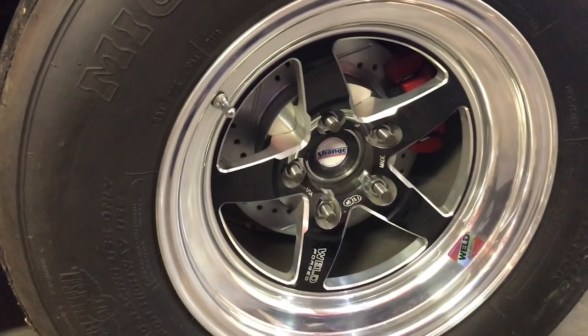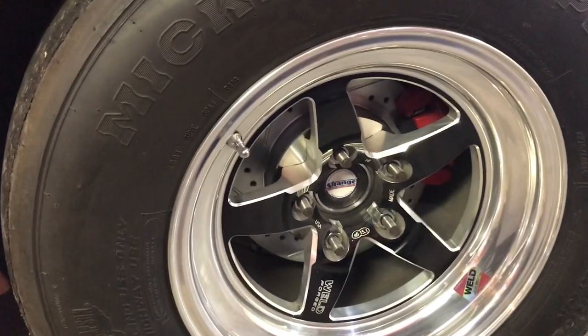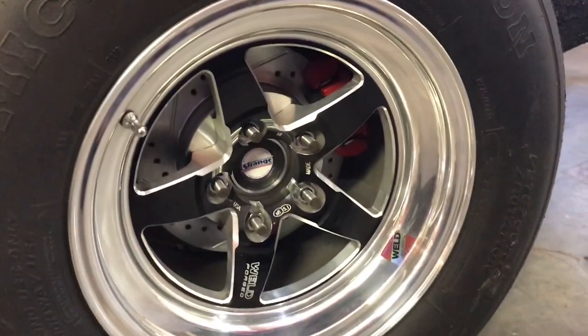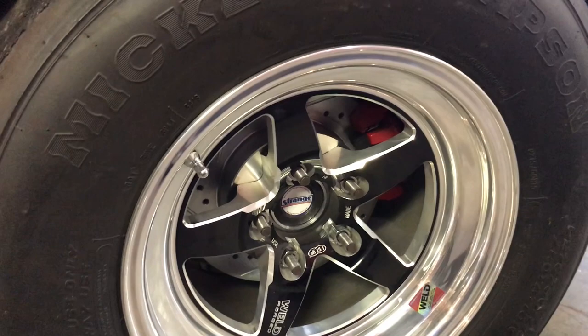On my car, I got a couple cool parts. Where I left off, I was talking about the brakes — I got them on. I did get those brackets from a company called North Race Cars. They literally bolted right up. I had to grind one out a little bit with a Dremel just because it was microscopically too small of a hole, but other than that it worked perfect. I got a brand new set of SN95 rotors and calipers — just all brand new. It looks great; it makes the wheels look a million times better. I just cut and reflared the OEM brake line so I didn't have to run an adapter to the braided lines on the SN calipers. This is all done and it turned out really sharp. It should stop a lot better hopefully.